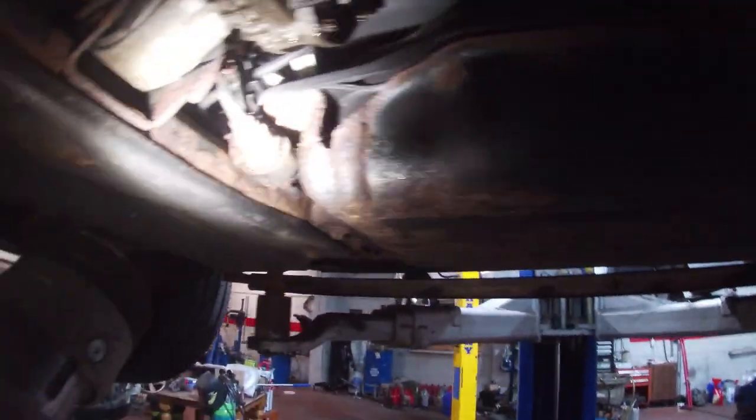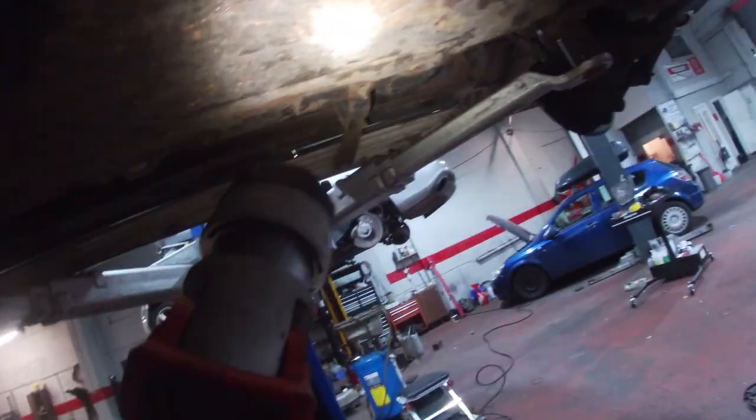So that's your pump that's feeding your night heater. Obviously your tank. The tank valve is a bit rotten. You can see it's still got some of its original powder coating. I've seen them much, much worse than that. I did stick a magnet to it and the magnet did stick to it. So I would recommend changing it, but it's not desperate at the minute.